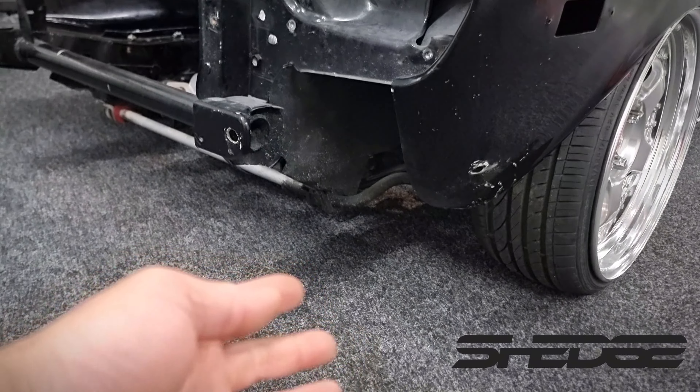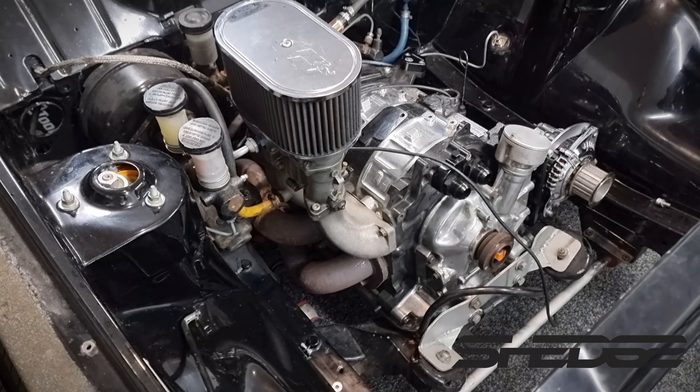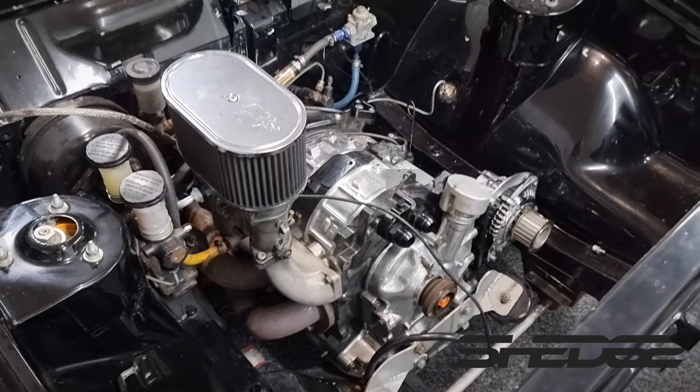It's currently just a 13B ported motor, a little series one gearbox, and it's got a little Mazda LSD diff in it, so we're going to be selling the gearbox and the diff out of it. Obviously we'll make a whole new exhaust for it — quite a shame really because it's actually a really really nice sounding exhaust: it's a twin with two resonators in the middle out to the back to a Super Trap. It's a really nice deep sounding car, not really a real buzzy tinny car.